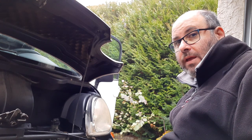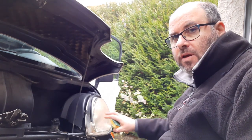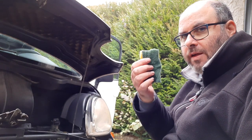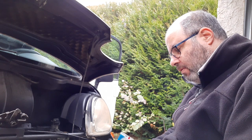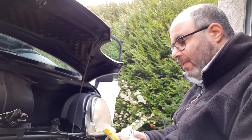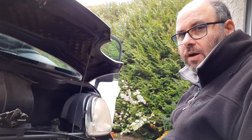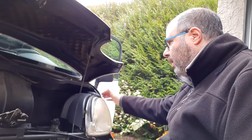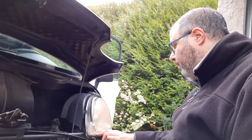Hopefully you'll see what I'm doing. I've read that you put just a little bit on and create big circles on the lamp with the toothpaste, using a slightly moist kitchen sponge — obviously not the rough side. I'll apply it to the sponge to avoid mess. One advantage here is that you usually need to mask off bodywork on cars, but on this van the nearest bodywork doesn't even touch the lens.